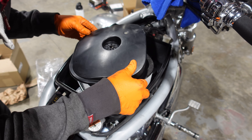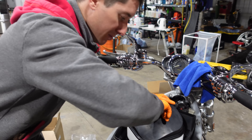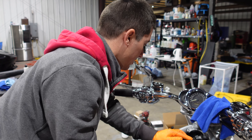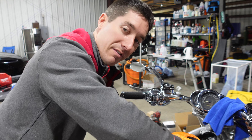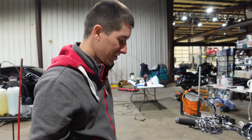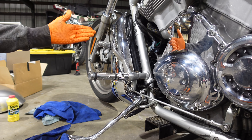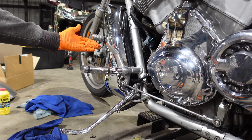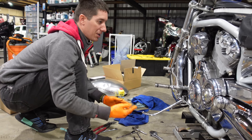Then we can move on to trying to make our clutch work. This is all we need to do up here - I'm going to wait until we bleed the clutch before putting the air box cover back on. Clutch is coming up next, and the mirrors, and then I should be able to ride this thing for the first time properly. I just finished adjusting the shifter too - the shift linkage is now straight up and down, putting the shifter right in line with the brake on the other side instead of being all the way down. So I think I'll be able to shift the bike now as long as we can make the clutch work.